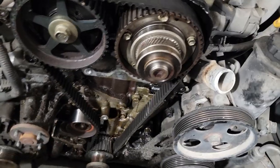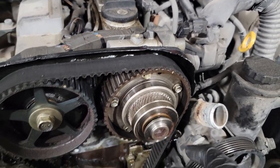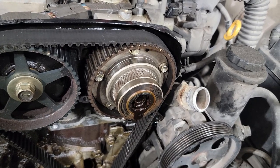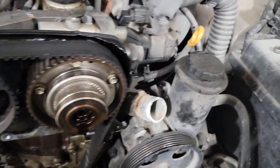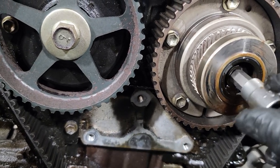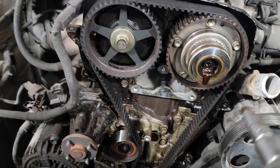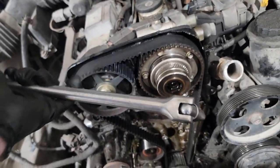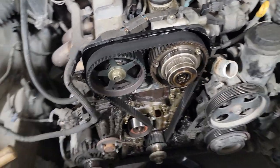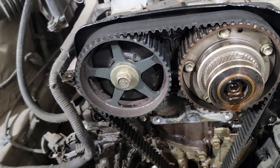It doesn't take much to get this one off, but on the inside if you're unlucky you will strip out the hex head because it is a hollow head. This will typically leave you needing to take the belt off so you can bleed out the cam gear. I'm going to break this loose with it on. If I'm lucky it should just break loose — had to use the jack handle as well and she came right out. That's not even a big bolt — I guess from age and use it would make sense. That's a 10 millimeter on the inside.